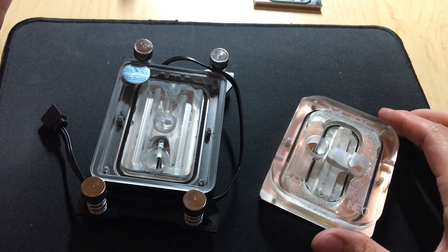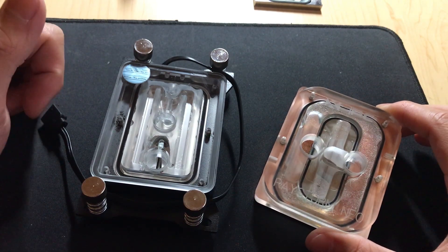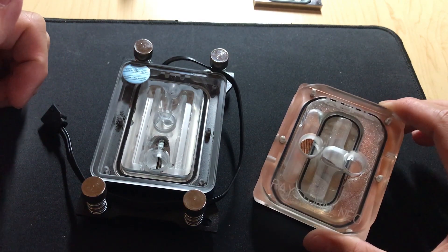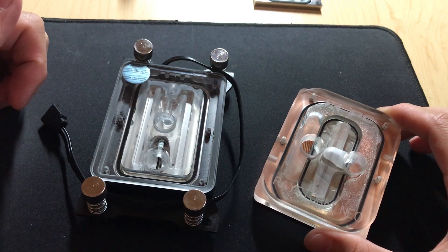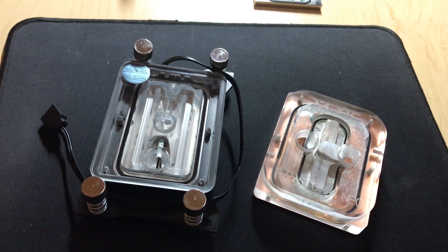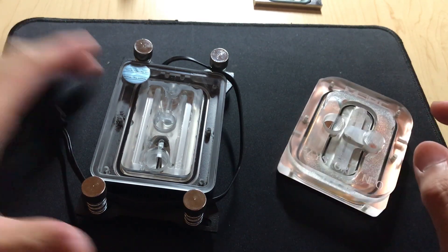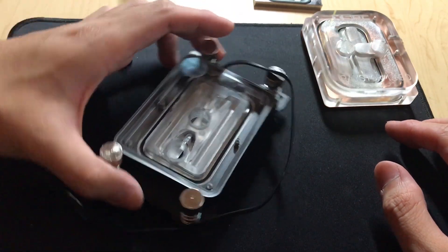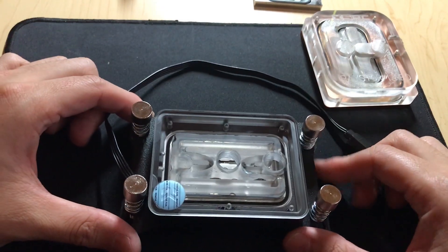Point being, I have one of these blocks in a full tower with two 480s connected to two Titan XPs, and my chip will do 4.05GHz with an offset of about 210. For this quick little test I ran it with a static voltage of 1.3575V at 4GHz, and pretty much it comes really close. I think it's finally kind of a good product — it took them three tries technically, but it's finally worth buying a product from EK for Threadripper.